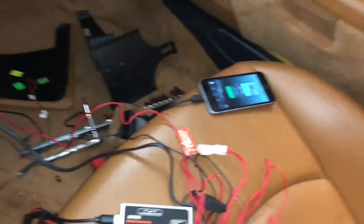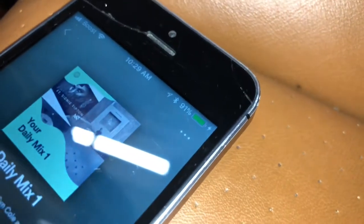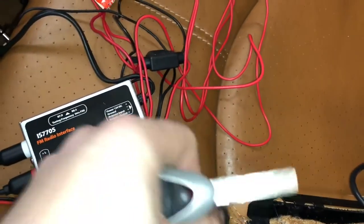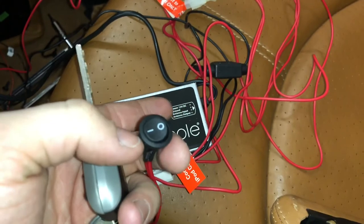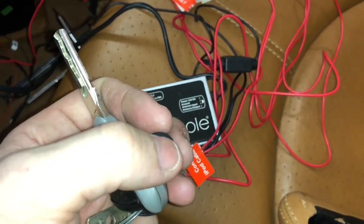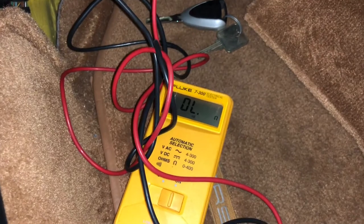The outlet may not turn off when the car is locked, which means the switch might actually be useful. You might have to install it somewhere accessible and only turn it on when using the Lightning port, otherwise it will always be drawing power. If you're looking for a switched 12-volt source in a 987, there's a thin orange wire in the loom — with the key in the ignition you get 12.45 volts, take the key out and you get nothing. That's what I'm going to use for the modulator.